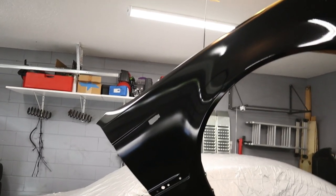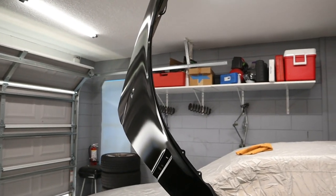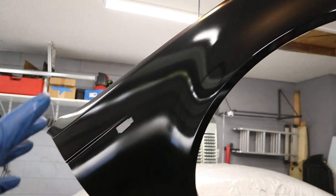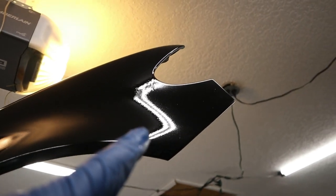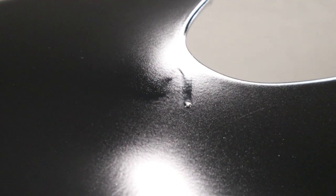We're two coats in. This gun is really different than spraying with a spray can. Like, it comes out a lot more aerated, a lot wider, and it feels like it dries quicker. I actually got a little too trigger happy. Up here on the corner, you can see the base coat's still drying, and I have a little bit of runs there. So I definitely just went a little too heavy in this corner because I knew I needed to go a little bit heavier, but not that heavy, obviously.